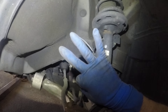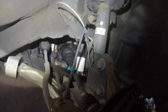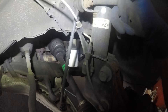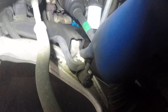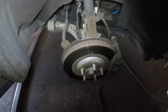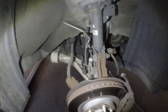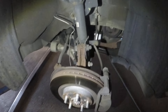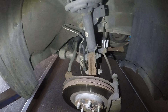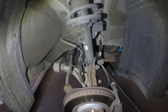To change these linkages, you're going to struggle. What you'd rather do is take off the nut and bolt here, leave it hanging with the strut, and move the whole assembly together — that's what we're going to do. So the double dribble noise is that bushing noise right there. We're going to start with the struts and linkages together.